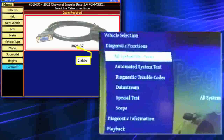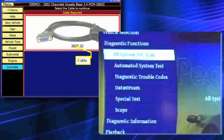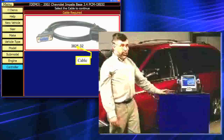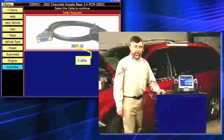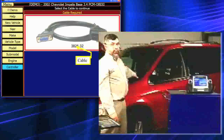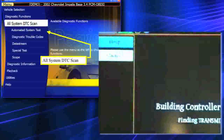There were many modules available for this vehicle. I did select engine — that's where the fault code is. However, I need to look at other modules to see if there are any related fault codes, such as traction control or ABS. Related fault codes might be part of the repair, or they might be repairs I could upsell to the customer later. So we're going to go to All Systems DTC Scan. The Pegasus will actually go out and physically talk to each and every module, automatically switching the VCI to do the talking for us.